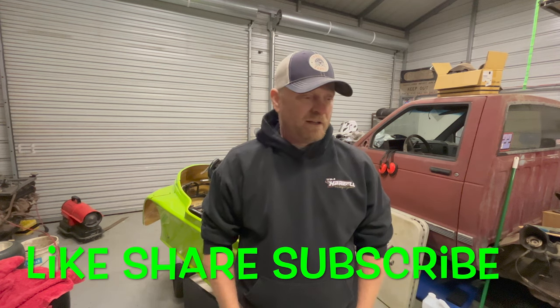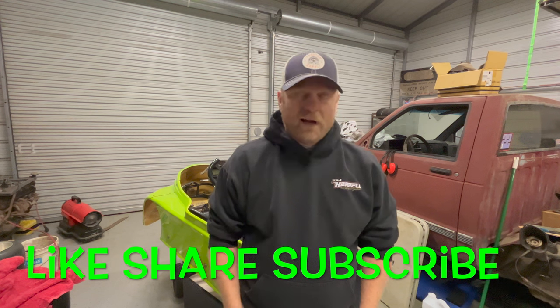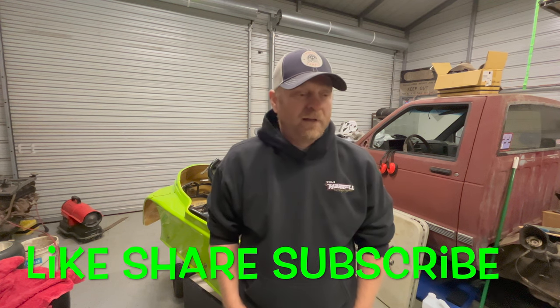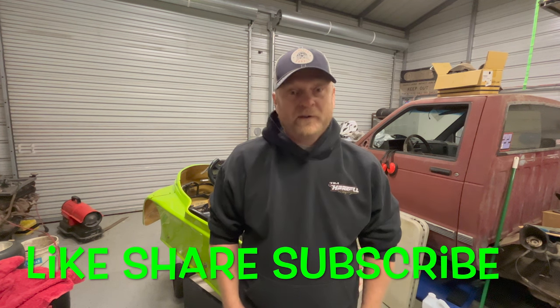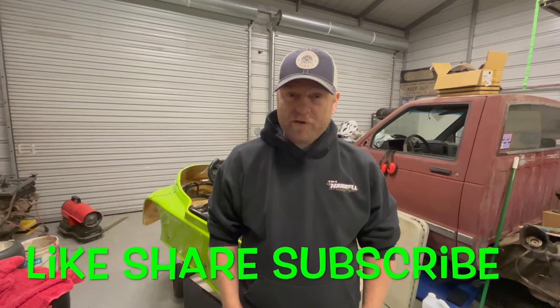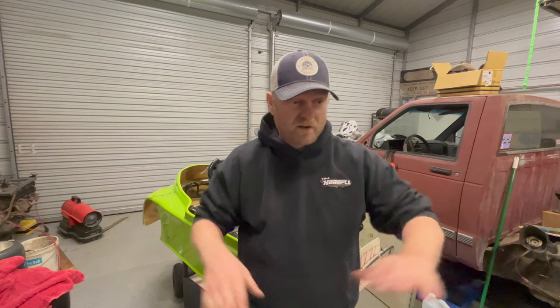You saw that and how I cleaned them and put them together and what lube I use, how I would store them if I was gonna store them. And the ultrasonic cleaner works pretty damn good. I think if it was like after this next race, if I just pull all the bearings apart and throw them in there, I won't have to clean them in full details like I did today. Just pull the seals off, throw them in there, go about my business.